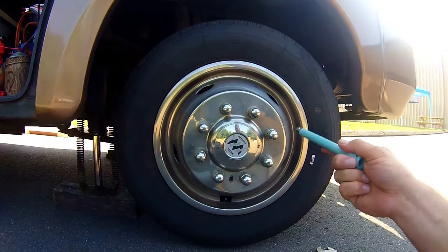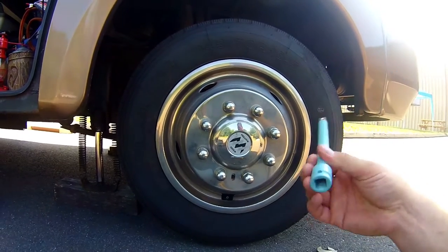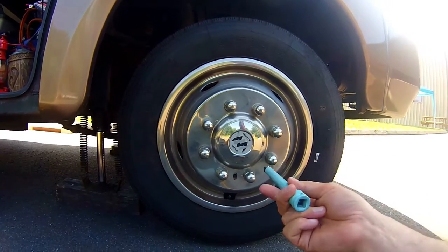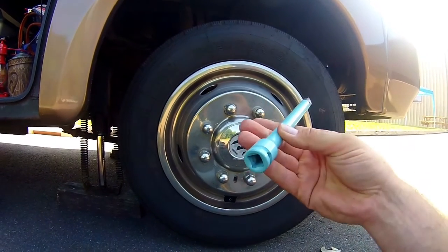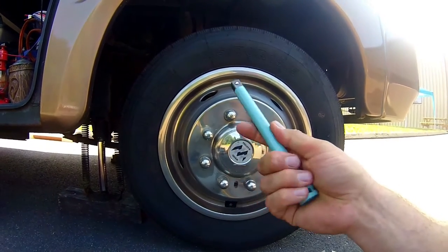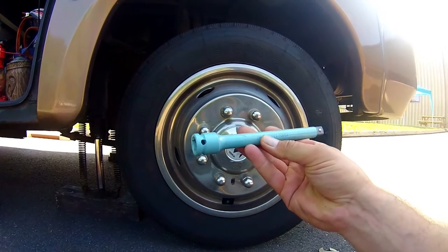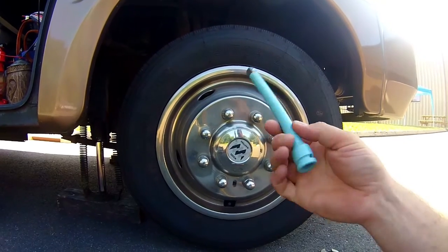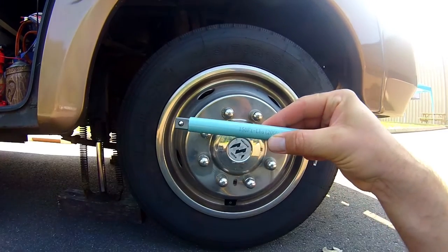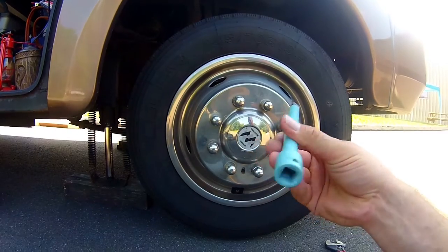The specs on these rims, the 19.5s, the foot-pounds originally was 140. From what I understand, they did a service bulletin and changed it to 160. I went right in between with 150. And then if need be, I can just snug them down a little bit or really just drive them really good. I got misinformation when I bought the stick, because I was thinking that 150, or 155 or something like that, was the right amount, but I figure I'd be safe with 150. If you guys think differently, please, by all means, leave me a comment below.